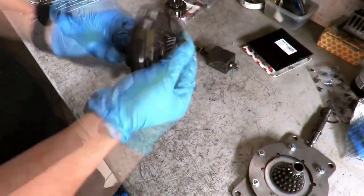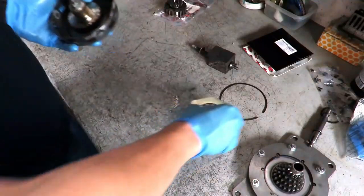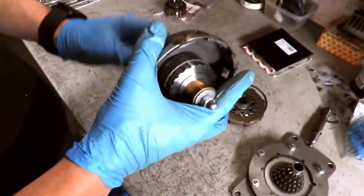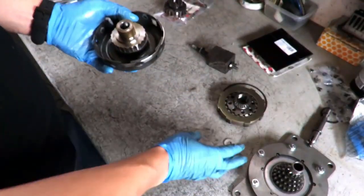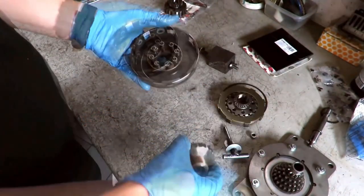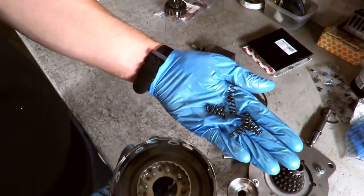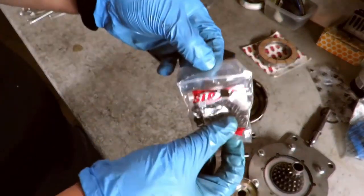For this engine, I've chosen to mount a 9-plate clutch produced by Surflex, which will be able to keep the engine torque at bay without using excessively reinforced springs. Above all, there are only 8 springs, so even putting the hardest ones on the market, as we'll do, the clutch is never very hard, as the 7 springs with Malossi springs can be. We remove the old springs and we take the new ones.